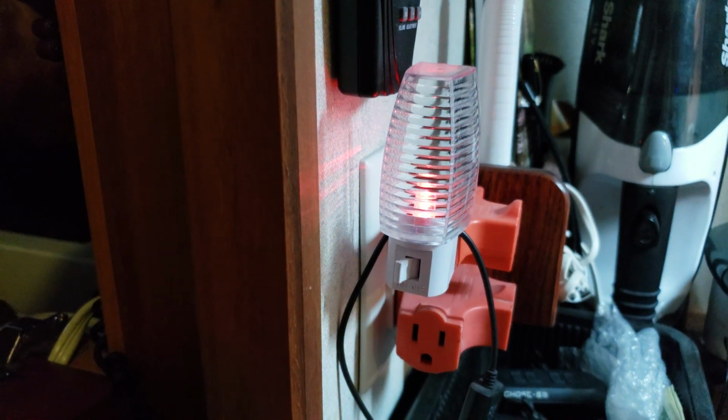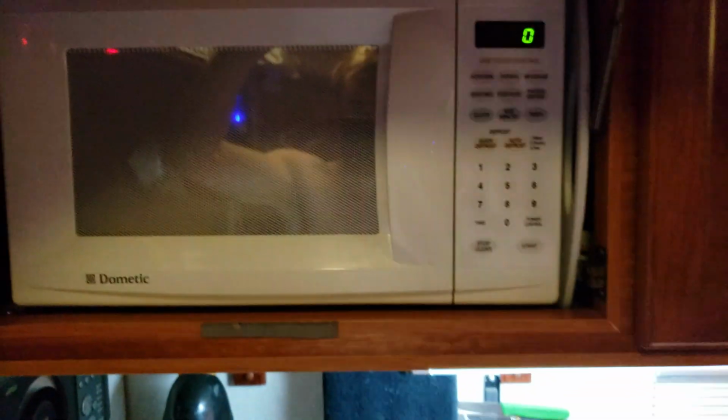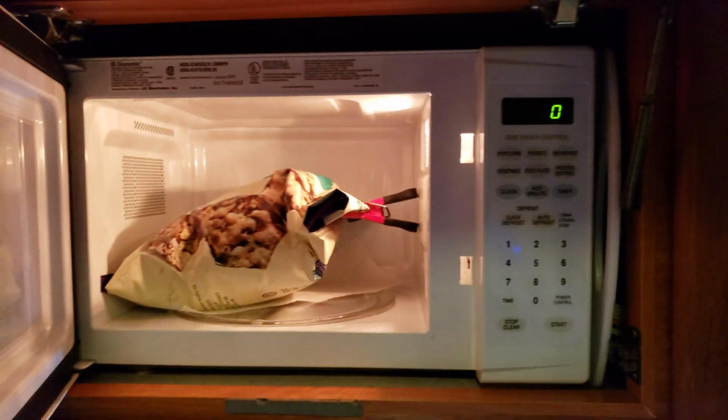So there's a 1500 watt pure sine inverter just bolted to the top of this. And then I got lots of boxes and paperwork and stuff. Unfortunately, the guys that installed my inverter weren't the smartest, and instead of wiring it direct, they plugged it in, and totally backwards. And there's not a trip or a junction box. So I got to have it all redone when I get a chance. But as you can see, the inverter is running, and I can run the microwave off of the inverter and off of my lithium batteries.